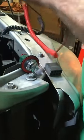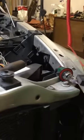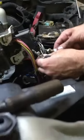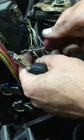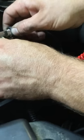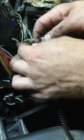I'm going to go one step easier on this. Because if you're going to jump socket to socket, you're going to have to splice in and run a wire all the way down under the radiator up to the other socket. You can do that — that'll work. I was kind of cheating just to test it using my jumper leads. But remember, this socket wasn't working. In here I have my two low side drivers — you can find a wiring diagram online for these. I spliced them together and bam, I got a headlight. Because this side was dead — this is the dead driver, the $800 driver that you can't fix. I'm basically just running my driver for this headlight off my driver for that headlight.